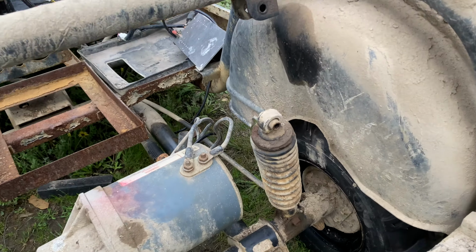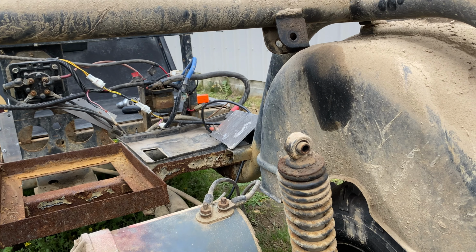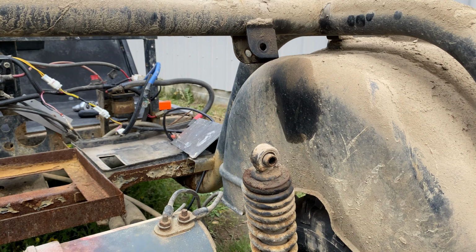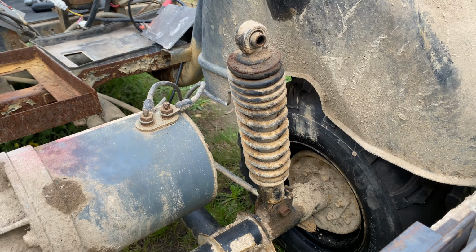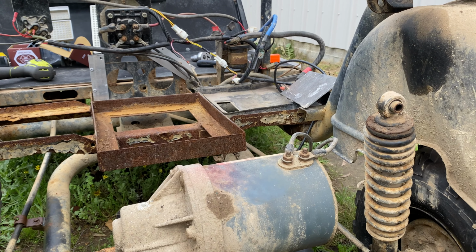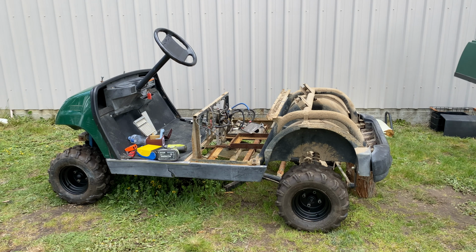Anyway, moving on to these shocks, I will have to get some steel for that, so that might have to wait till next week's video. The mounts come down at an angle, so I'll have to come down an angle and then straighten up, just because if I do move those shocks, they'll end up probably rubbing through on the mount there and wearing them out, so I don't want to do that. But I think the next thing to do is we'll put the body back on top, just sit it on, and then we might see how that roof fits.